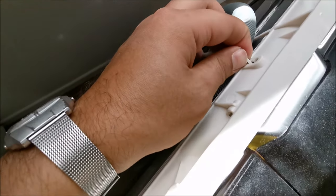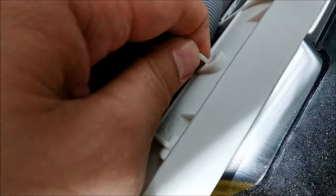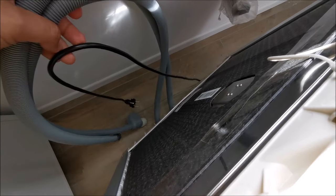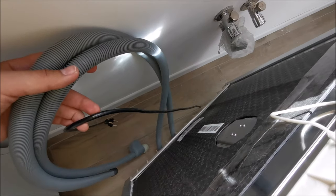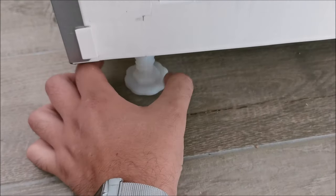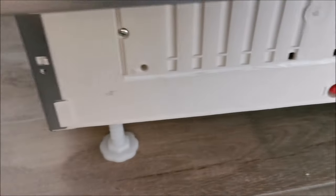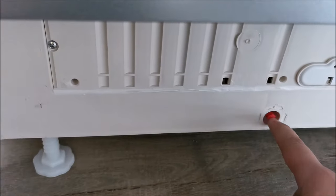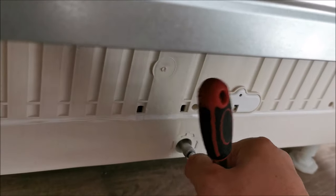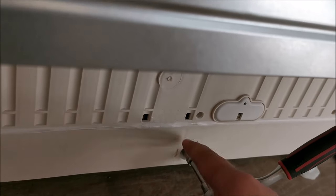At this point we're just pushing the unit into place — this is simulating the edge of a cabinet. In the back, you need to lift the unit to access the three connections: cable, water, and outlet. To adjust the front supports, you simply rotate them. For the back, you need an 8mm hex key — tighten to go up, loosen to go down, as the arrow indicates.